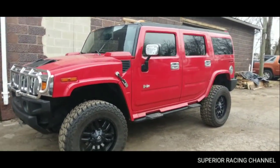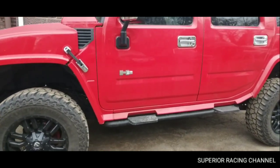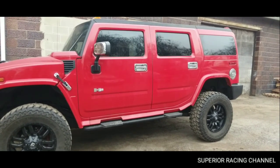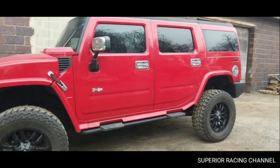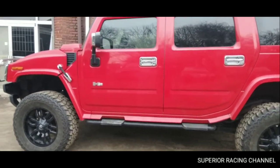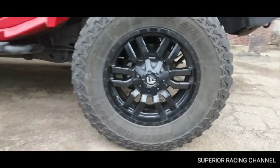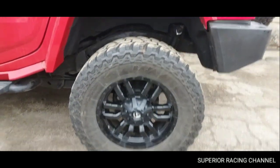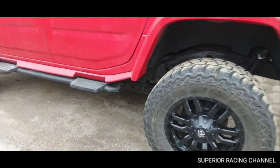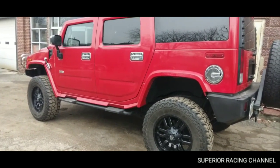if you end up doing one of these, just know that those torsion bars, if they rust, there's just no way in hell. I torched them in half and beat and beat till we were blue in the face. Finally got those things out. And just for shits and giggles, even though we were getting new keys, I took them over to the press to press out the piece of the torsion bar, and boy, it was in there. There's no way anybody could have got those out.